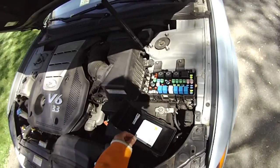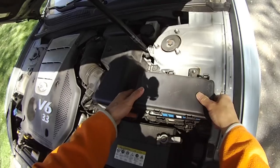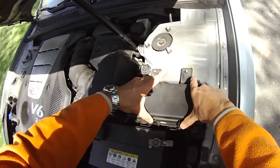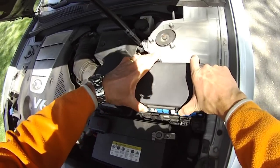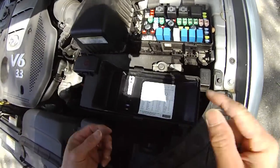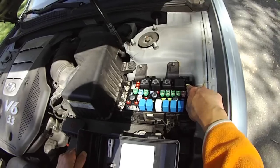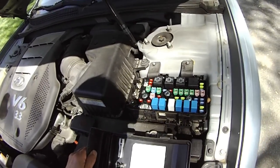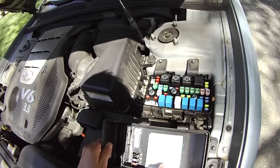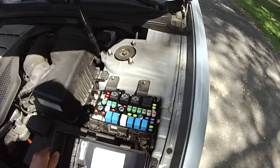The high beam is gone too. Here is the fuse box — I open it up simply by pressing these four buttons. I can see here it says 23, which is this yellow fuse. I guess it's 20 amps; number 23 says 'H,' which I think stands for headlamp — the low beam.